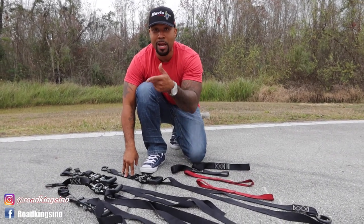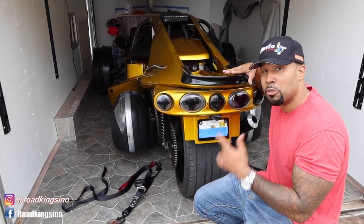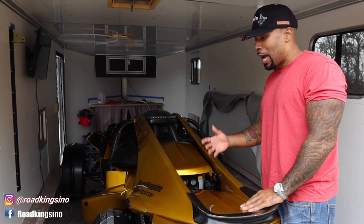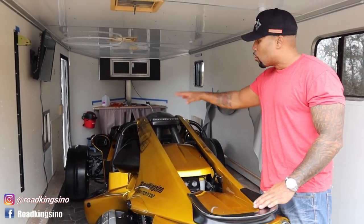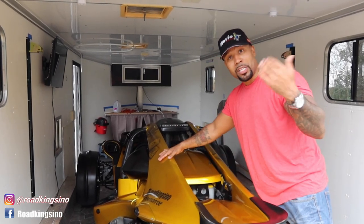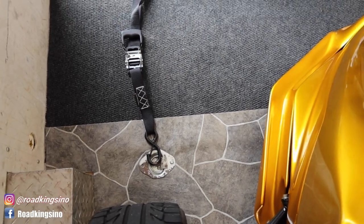After I have the straps laid out, I like to lay them out in the trailer at the strapping points — the mounting points where I'm going to be strapping the T-Rex down. For the purpose of this video I removed the bed so you can get a clear picture of what I'm doing, and I moved the T-Rex back so more light can come in. Every trailer should be equipped with D-rings in various places. Normally I'd push the T-Rex and center it over the wheels for even weight distribution, but I've got it back for lighting. I've got my D-rings in the rear and D-rings up front with straps in place.